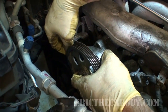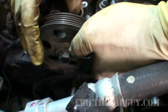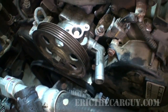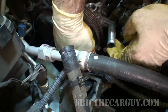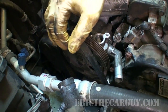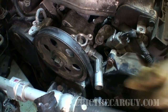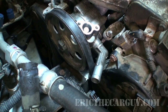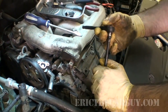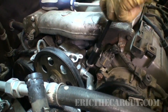And get the bolt for the back. I'm just going to thread these down finger tight. And with this one, I'm going to do it with my socket. All right, make sure it's still on the pulley underneath. Back on there. Now, I would highly recommend that when you set the tension like I'm doing now, you do it with a hand ratchet and not with some air tool.